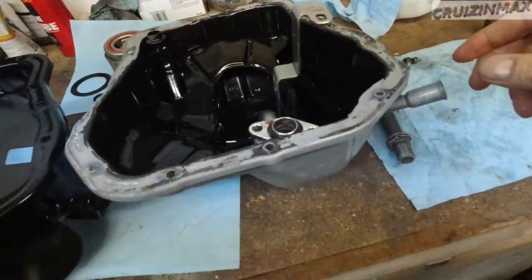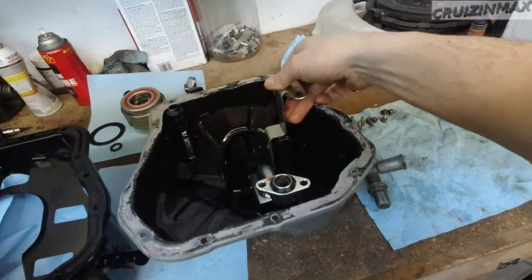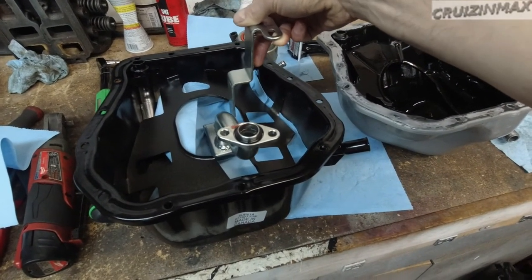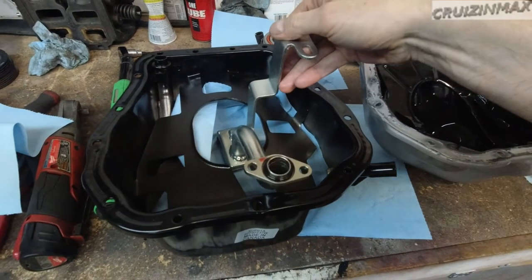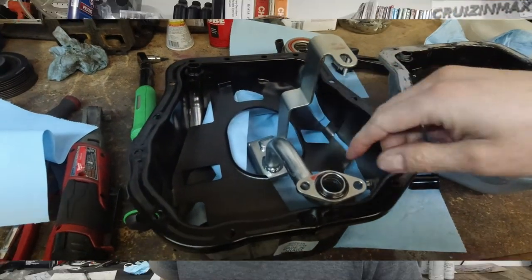But there's a problem - the baffles inside are in the way. The pickup tube sits right about here in the stock oil pan, and the top baffle and the bottom baffle are both in the way. It would need some cutting right here - that's probably what I'm going to do, because I really want this oil pan to work. I'm going to cut this top baffle and then get to the bottom one. In the next video I'm going to finish modifying the oil pan, and I'm also going to install the Cobb flex fuel kit. Like, subscribe, comment - do something - and I'll see you soon.